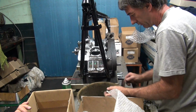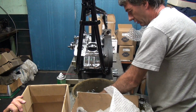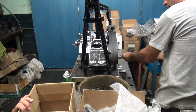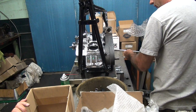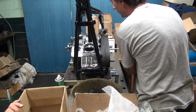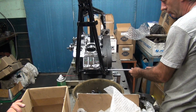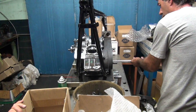It's like, ooh, you're careful. It's too big. The frame's bent. Now I got something else to worry about when I'm switching that motor. Never thought about shims. Yeah, well, if it's got soft feet under the motor, you gotta shim. But you probably won't have any problem. You hope.